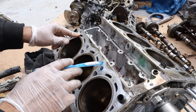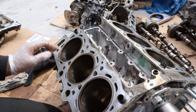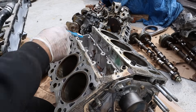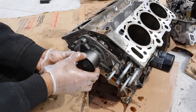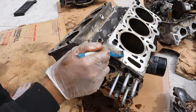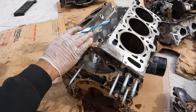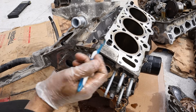At the top of the engine block there are holes that feed oil to lubricate the head and variable valve timing system, and there are a lot of return ports for oil from the head to drain back down into the crankcase and be ventilated again through the PCV system. The cooling system works by having the lower radiator hose bring coolant in through the thermostat, which channels coolant to the water pump, which feeds it to the two sides of the cylinder block. They've used an OEM gasket on the water pump — try not to use paper gaskets. The coolant then flows over to the coolant jackets around the cylinders. This engine uses a semi-closed deck design with reinforcements between the cylinders — it's not just an open jacket, which lends to the strength and reliability of the block. Many lower-class engines use a fully open deck design to improve cooling.